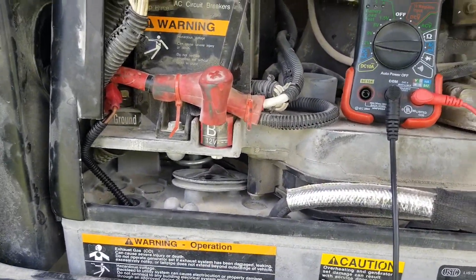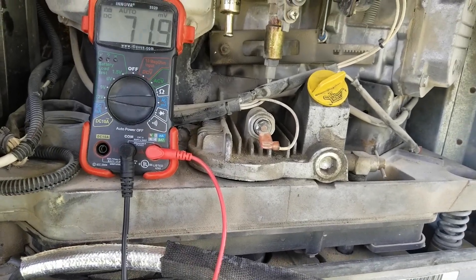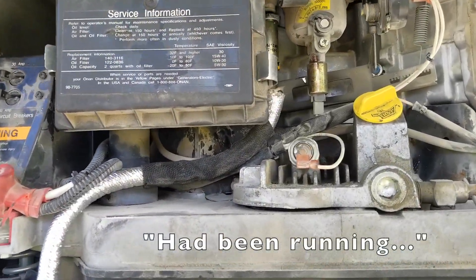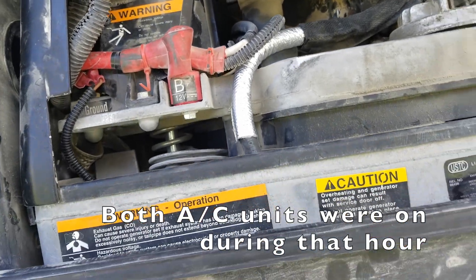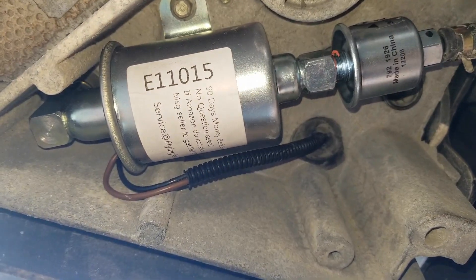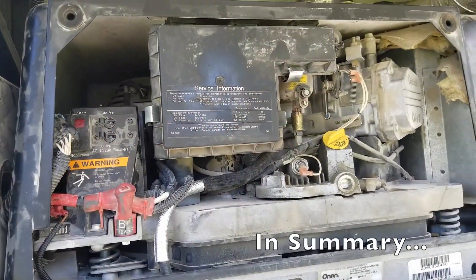Simple fix — I had to drag all the tools out again. That extra millimeter of wire — I didn't have it plugged in all the way. Now listen to her bark! It's been running for an hour now. I replaced the fuel filter, the fuel line, wrapped it in heat shrink, replaced the fuel pump, and it has been running like a champ.